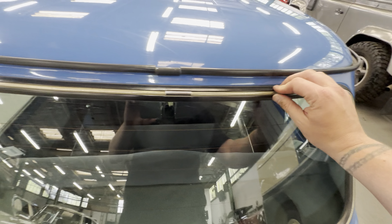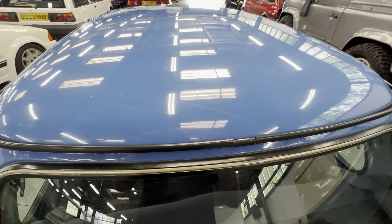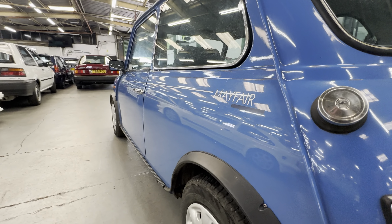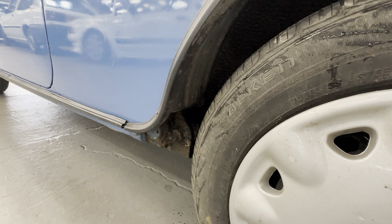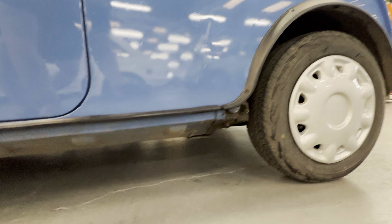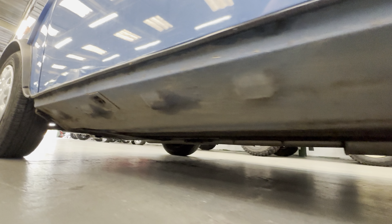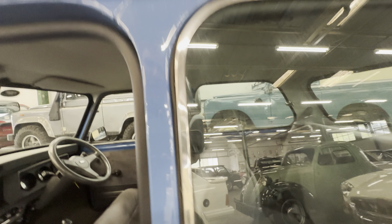All good on the seal around the back screen — nice and soft. Got a trim finisher on the roof as well — normally that's gone missing by now. Coming round on the passenger side — nice and straight all the way down. Inside that rear arch, nice and solid. You can see the suspension pick-up points, covered in a bit of road grime, but you can't see any real corrosion coming through. A good scrub would do it good. Open-vent sills — no sign of any corrosion peeking through. Same story on the seam on this corner and on the top.